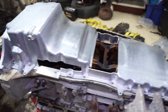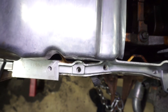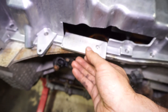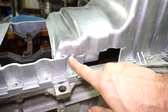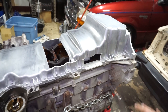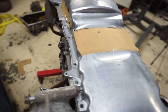Here's kind of what I've got going on so far. This side is actually a little bit wider on the back side than this part, so it moves straight back but this part kind of jogs out a little bit. I'll have to do a little filling. I cut this section down a little more so I can angle a piece in from here to here. I do have some scrap aluminum flat stock that I'm going to use to weld that in. This side actually turned out not too bad — I'll just weld the long section and fill this in, then go over the top with some plate. I'm going to bolt the thing down and start fitting pieces and tack welding them in.